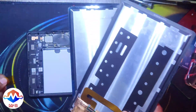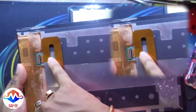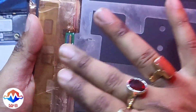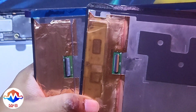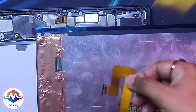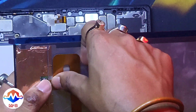Here I've just peeled off the Kapton tape from the connector, which was supplied by the manufacturer. This was not repaired before. As you can see, that is the connector — you just pull up. The flex cable has a little bit of glue holding it to the display, so be very careful while pulling up. I found that there is a locking pin you have to press down to lock the flex in, and they are on opposite sides, but the same flex will work. Just line up the white line with the connector slowly so you don't damage the flex cable, then push the locking pin in — and there is the complete display with the flex cable.